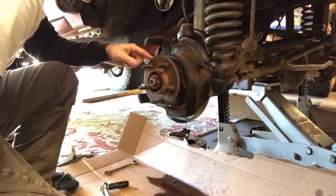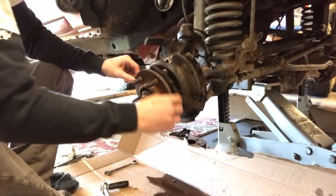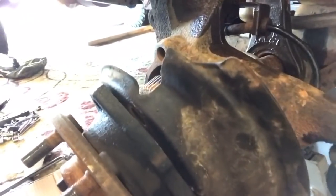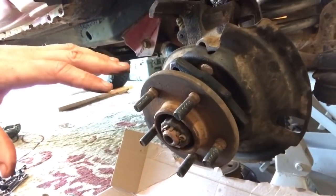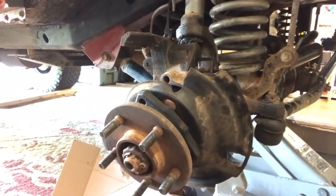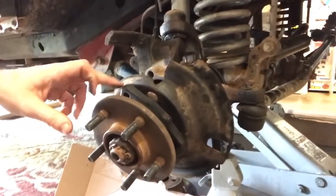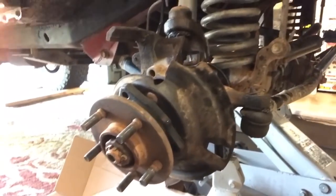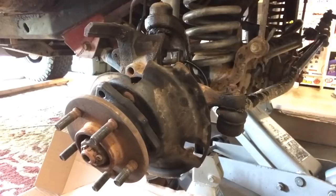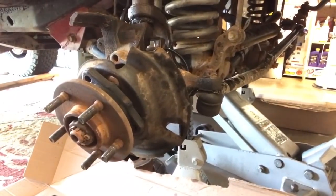Now that all the bolts are loose, you can just tap on this and the whole thing comes loose. Right here are the U-joints to your axle shaft, and the whole thing's just going to pull right out. You don't have to take off the whole hub unless you plan on replacing it. Your dust shield also stays in place. It's a good idea to take a picture of this stuff before you do it so that you know the orientation of how it all goes back in — especially the dust shield. If that goes on wrong, you're not going to be able to assemble the rest of the wheel end, and you'll realize it too late after your bolts are back in. Since I'm doing video I can go back and look, but taking pictures through each step is a good idea.